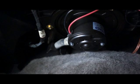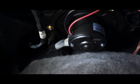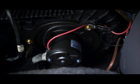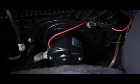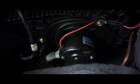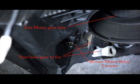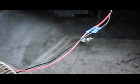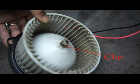In my situation, the fan was cutting on and off while I was driving, which led me to believe it was the fan itself and maybe the resistor. But there's a third option — it might have been the switch, the actual high-low switch for the fan. The key to knowing it's the switch is if it won't work on like position one versus four, or it only works on two and three — it works on some settings but not others. That would indicate it's the resistor for sure.